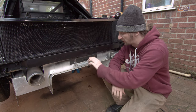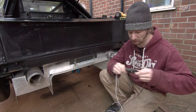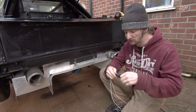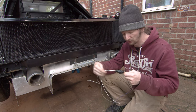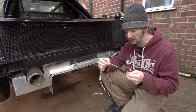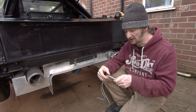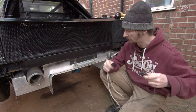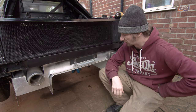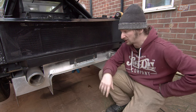I'm going to run a few wires into our replacement lamp, and to make sure it's all de-coupleable and workable-on, we're going to use a four-pin sealed weatherproof connector — as previously used by an O2 sensor on the exhaust of one of the cars we've stripped here. We'll have a common ground going to all the lights, and then one switched connection each for our fog, reverse, and tail light feed, so all of these run into the middle and we can actually disconnect stuff if we ever need to modify the wiring again.